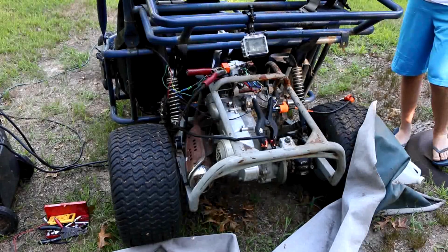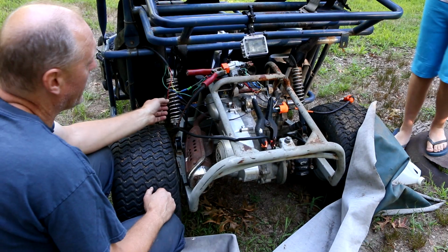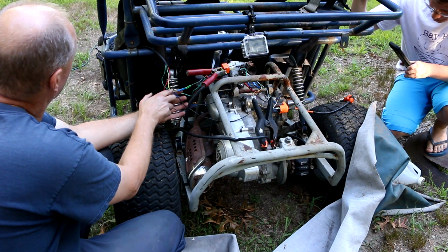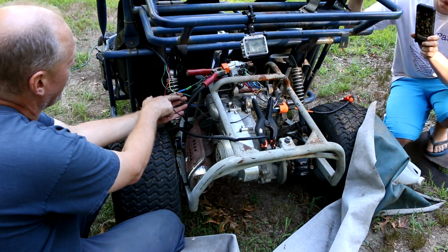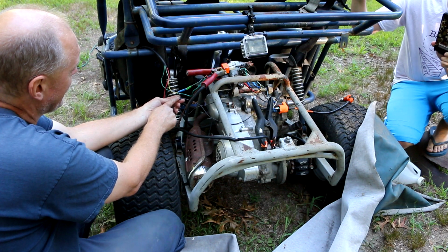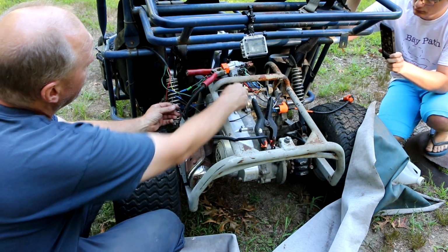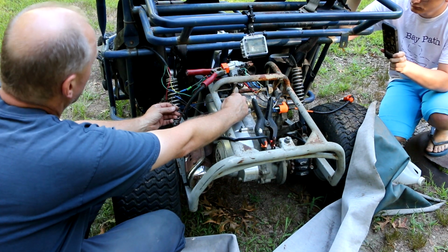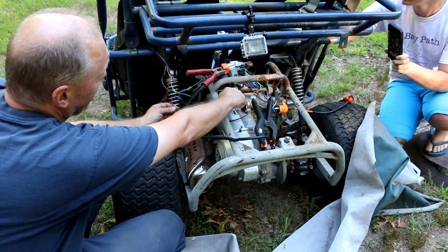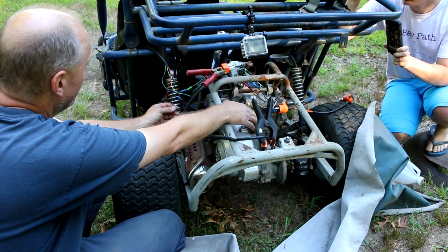All right, worked on the Yerf Dog a little bit today. Back to the wiring. I ended up running the ground wire from the wiring harness on the Yerf Dog. I put an inline splice here, split it into two wires. One wire I have going over to an I terminal that I terminated here on the block, so that's making the ground connection to the engine.